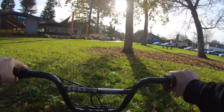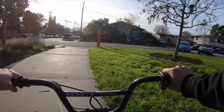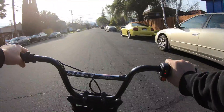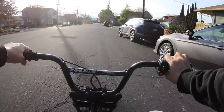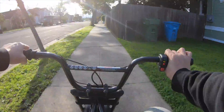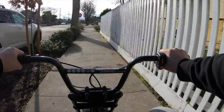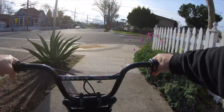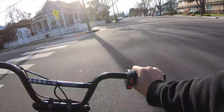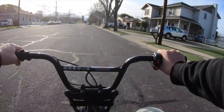The fat tires are super nice for riding off-road — tons of traction, no issues at all. We're only running 36 volts with what I'm pretty sure is a 1000W motor. It has good torque for 36V, but the top speed maxes out pretty quick — I'd estimate it's going about 12 to 15 miles an hour. The brakes feel fine but I need to check the chain tension because it's pretty loud, louder than any of my other bikes — I think the chain might be too tight.